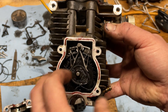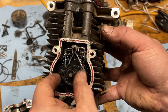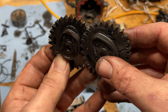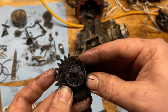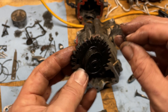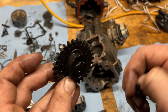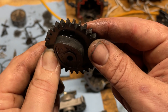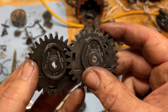You can see the wear marks — it's flattened out from spinning around, causing the exhaust valve or intake valve to open at incorrect times, or to stay open or closed longer than they should. This I believe is why the engine was not revving to full potential. Look at how gentle that slope is compared to the other one — the outer layer on this side has broken off completely. It's supposed to sit flat and wrap all the way around to provide a smooth curve. The valves have done a heck of a job mashing things down.